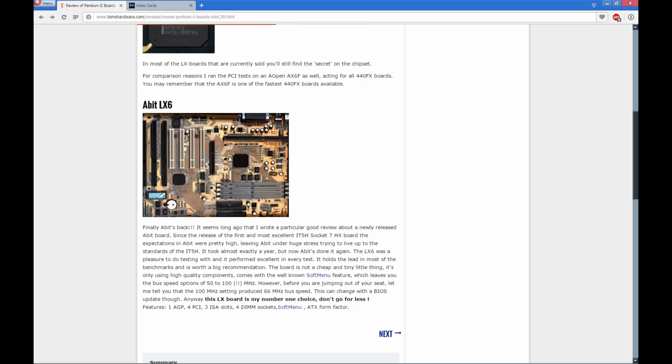I don't know if they had thought of that yet, because that little thing wouldn't actually become a normal thing until the BX chipset, to put a divider in the AGP bus clock speed, whatever you want to call it. To what is it, 1.5 I think. So 100 megahertz is still running at 66, with a 1.5 divisor, something like that.